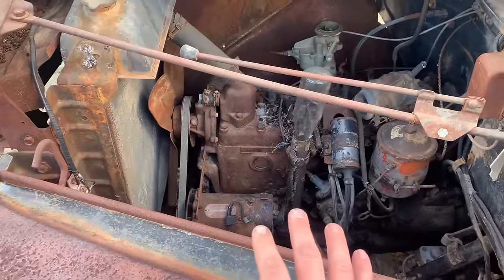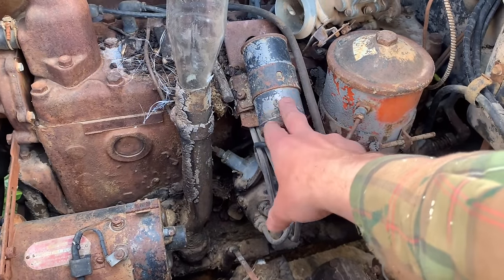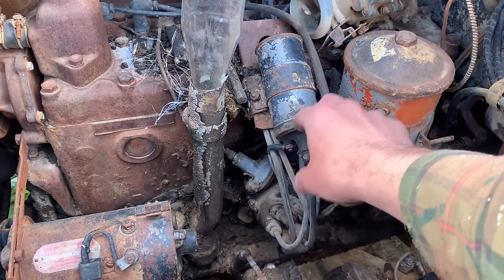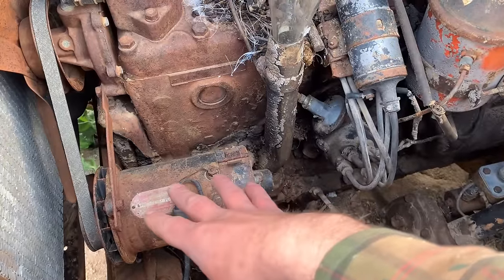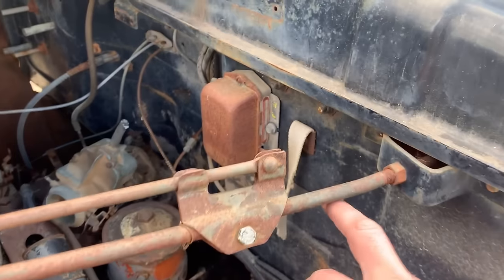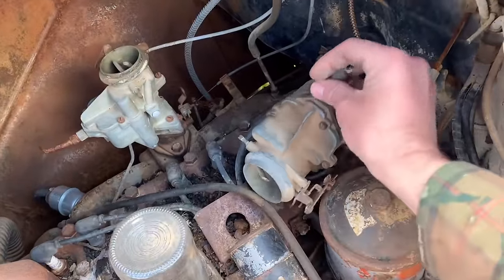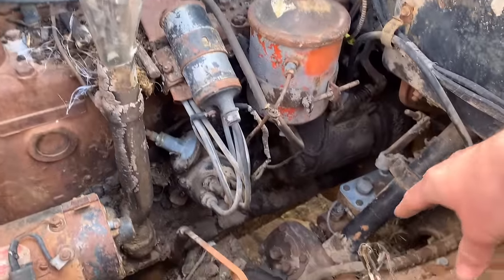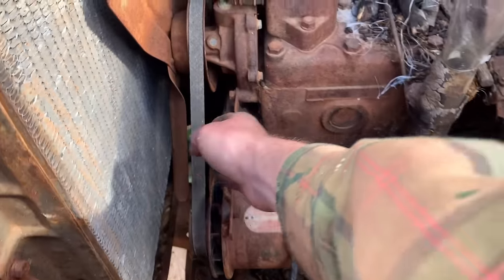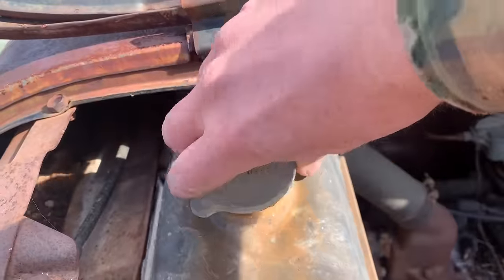This thing is bone stock, never been touched. I'm just looking for anything major that's missing that's going to stop us from getting it running. It looks like our coil is there — a good thing I did bring a six-volt battery. These are six-volt positive-ground trucks. Here's your six-volt voltage regulator. All of this is still hooked up as it was. Nothing has been touched on this other than an extra carburetor — not sure what that's about. Our spark plug wires are there, our distributor's there, our vacuum advance is there, our auxiliary oil filter's there — generator, all the wiring, nothing has been touched. We even got a belt on it. Radiator's in it.